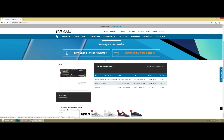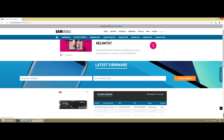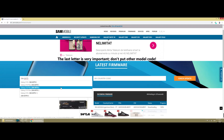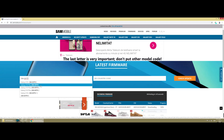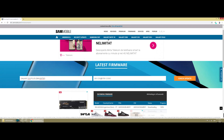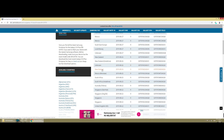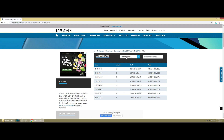Click on Firmware, then click Download Latest Firmware, and insert your model number. We have SMG975F, and you'll see variants: F, N, U — respect your letter, otherwise you can have serious problems. Click Check for Update. You'll see a lot of countries listed; for example, I selected Romania. I selected the Romanian firmware without any carrier attached.